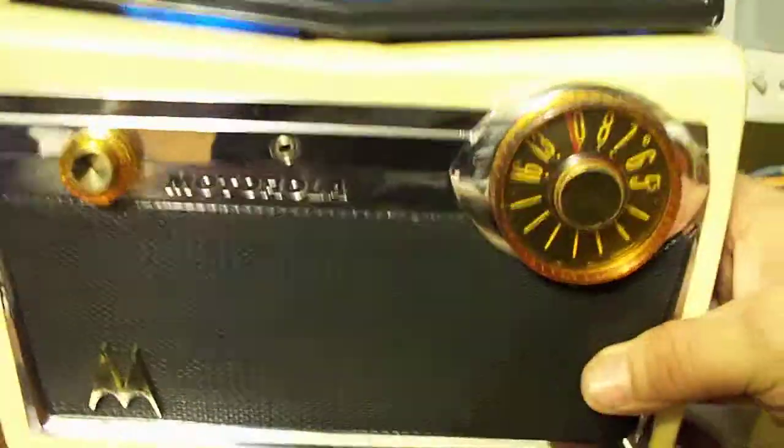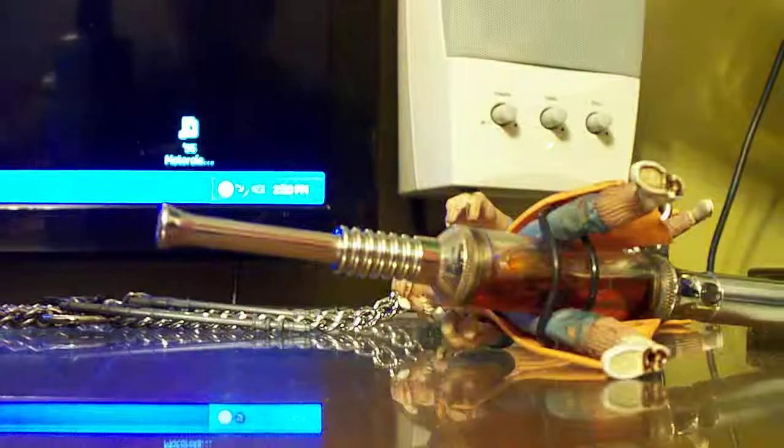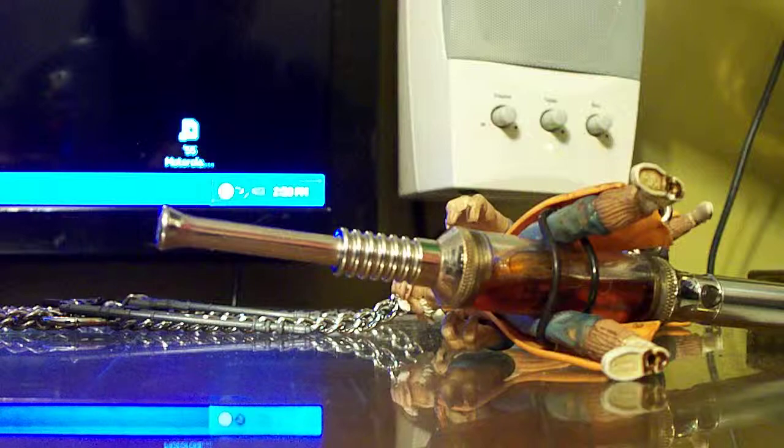Even the brass hardware is in really nice condition on this set. The AC plug is very similar to a modern one but the spacing is just a little bit different. So what I did is take a modern cord, heat it up in hot water to soften the rubber, and then force it onto the pins. Once it cooled down, the memory of the rubber material kept it stretched, so now it plugs in pretty easy.